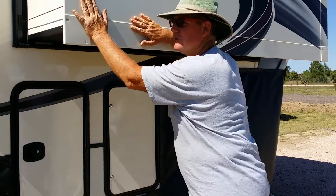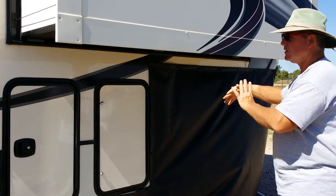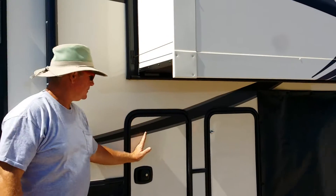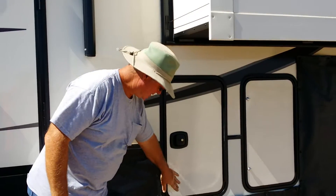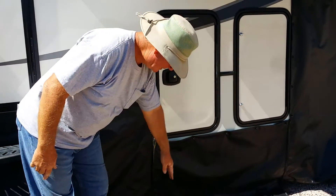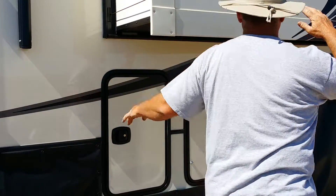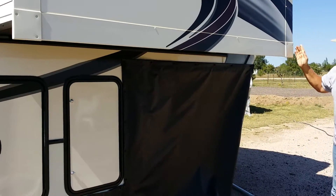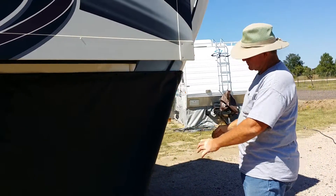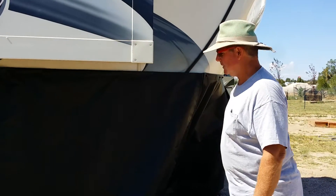This is the upper slide-out. We do not skirt these. We'll do all of this all around here, but if we try to skirt this, we still have to put snaps or turn buttons in it — and the doors are not that strong. Then you've got to put a zipper onto the skirt, and this piece is pulling on the skirt all crazy. Coming over here, you'd have to put a zipper here too — so not only is the wind pushing this way, the wind is pushing this way. We've done a few of them; they are major problems. We don't do them.